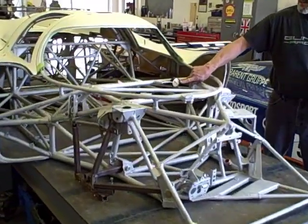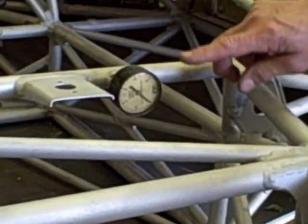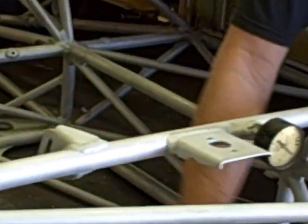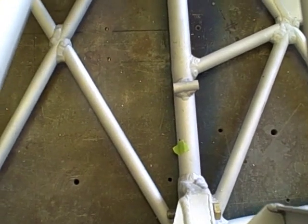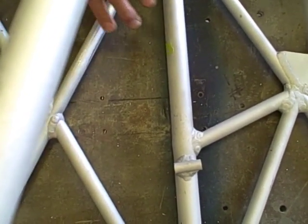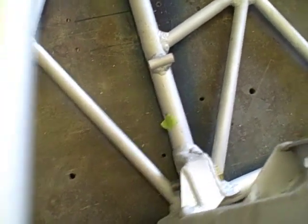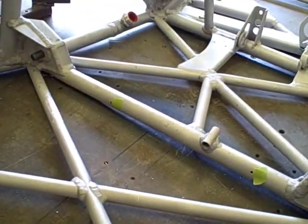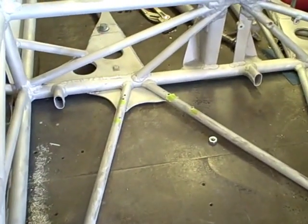Here's the gauge, which has been cleaned up now. We can only get about five pounds of air pressure because there's so many holes drilled in it. If you look down inside here with the camera, you can see tape. These are two holes that they held the floorboard in with — they just put a couple screws in it. Well, that's fine and dandy, except those holes are part of the chassis to pressurize it. Most of the time, a 917 floorboard was held in with tie wraps. Look around — you can see tape marks where there's holes or cracks in the chassis.